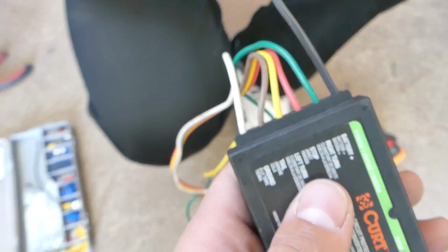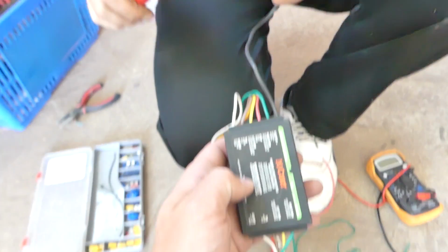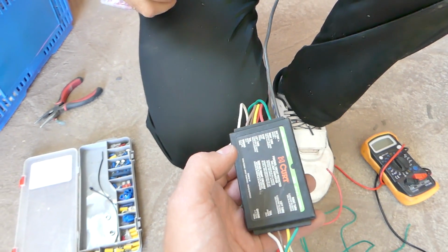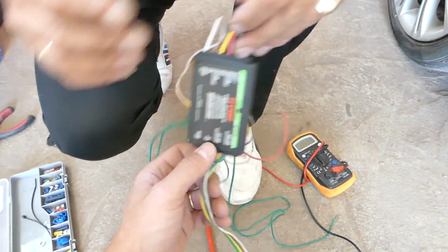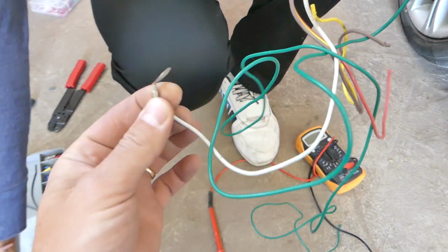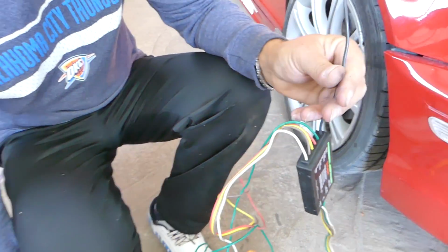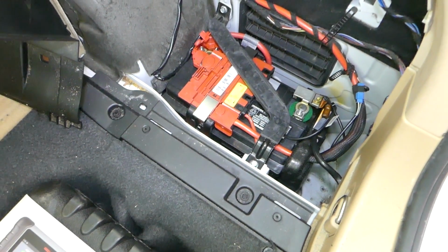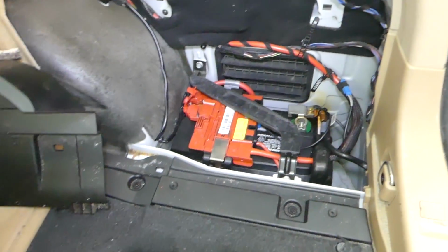This one doesn't make any sense. In my opinion, the battery wire, battery plus, is a black wire. Usually it shouldn't be black, I don't know why it's that way in this case. Ground wire is white. In most cases on trailers I've noticed that it's white, sometimes it could be black. So make sure the connection is good, perfect, and all the other wires we'll do later. Also, we already have a clip like that on the ground wire installed, so the ground and the positive are ready to go. I would recommend getting the original BMW equipment, but if you're doing what we're doing, which I wouldn't recommend, go ahead and turn your car battery off, that way you make sure that you don't burn anything in the way.